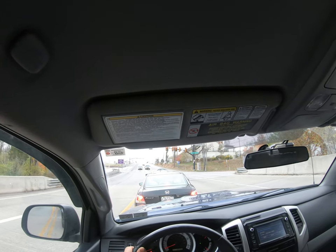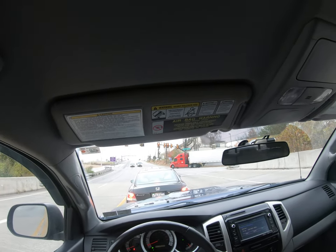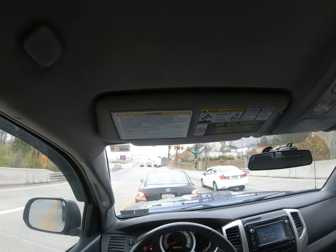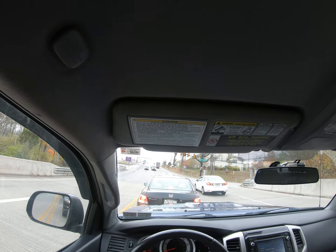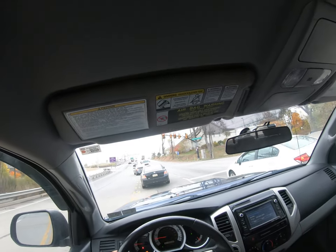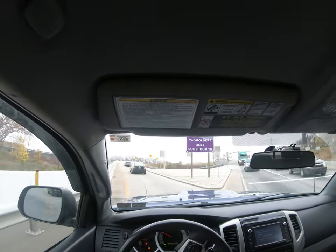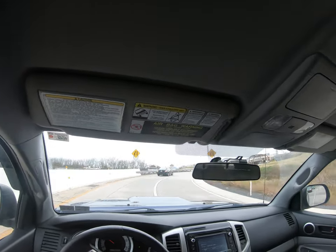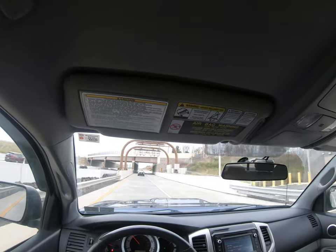I threatened Lemon Law, but I really don't want to get rid of my truck — I love my truck. After a little research, it turns out Toyota uses a needle bearing in their left front inner CV, at the end of the differential where the CV joint goes in. That needle bearing has a lot of play, causes a lot of slack, and around 55 miles per hour it loses synchronicity and starts wobbling.